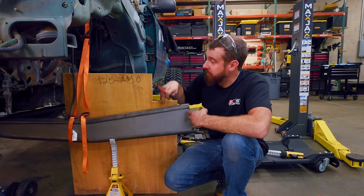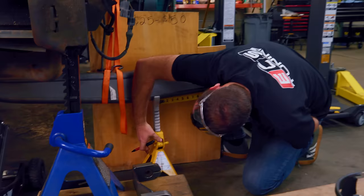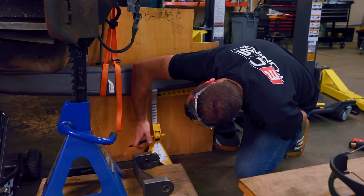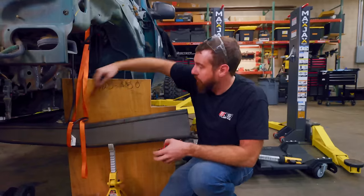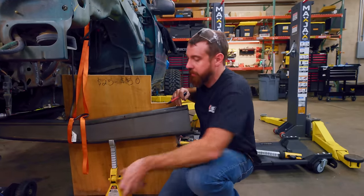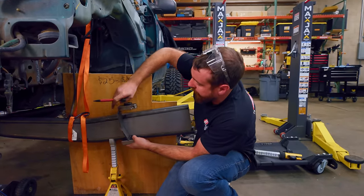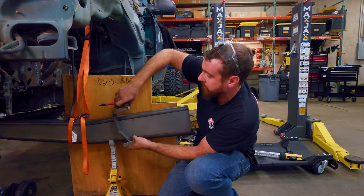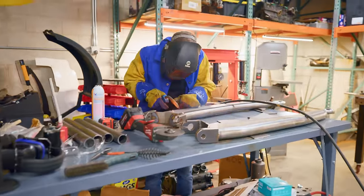Since these are cut-to-length beams, I'm using a piece of wood to bump up against the frame as a straight edge, and measuring off of that so I can cut the beams in the same spot so the track width is the same on each side. I'm going 13 inches off of there, and that'll let us find a spot where I can line up the spindle, set the camber, trace it out, cut it so it fits, and do the same on both sides.